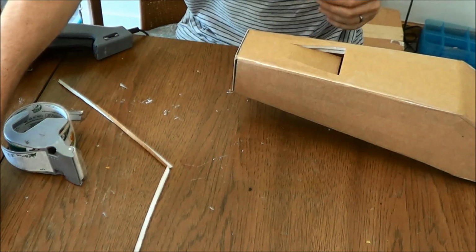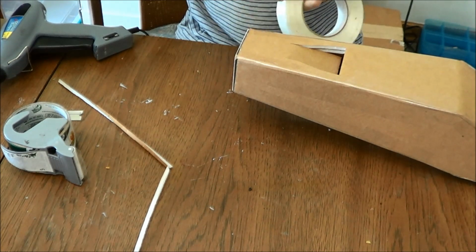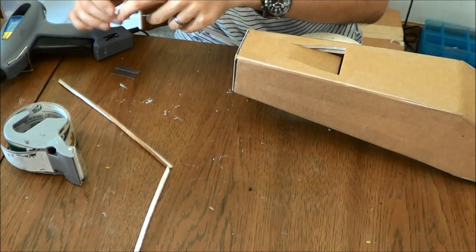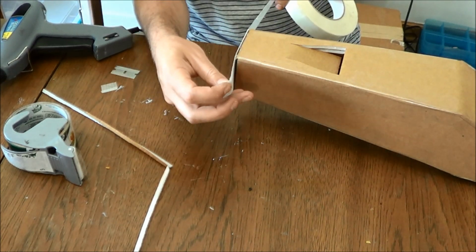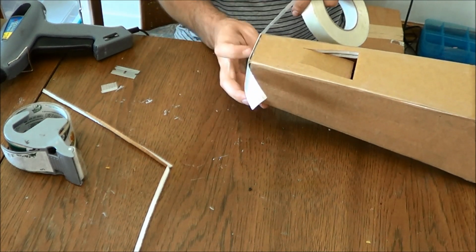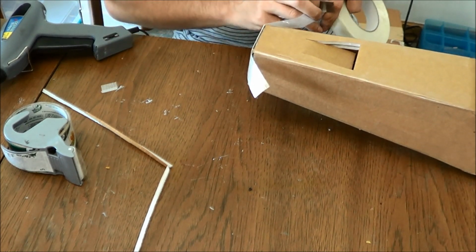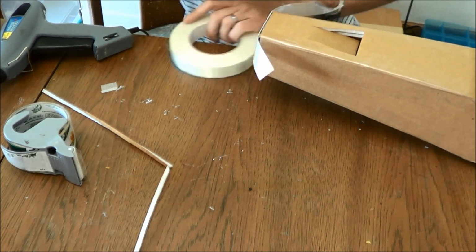Okay, so having taped all the corners here, get out some fiberglass reinforcing tape, strapping tape, whatever you want to call it, and we're going to put a couple of layers of that across our motor, or yeah, our firewall here, and that is because we do not want our motor coming off